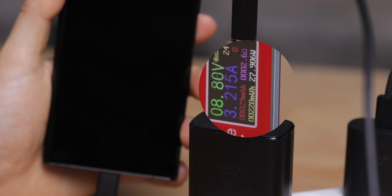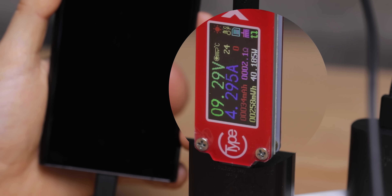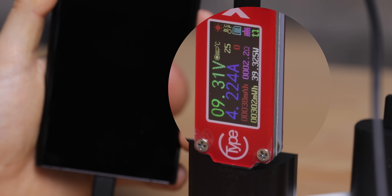The first thing we want to show you is that even if you plug in the older S21 Ultra to the 45W charger, it's the software that only limits it to 25W speeds. With the Galaxy S22 Ultra, our power meter shows a charge that reaches about 40W, so you do get faster speeds. Unfortunately, the faster charger won't make a difference for the older S21 Ultra — it will only work with the new S22 Ultra.